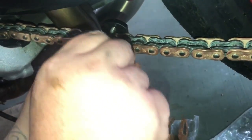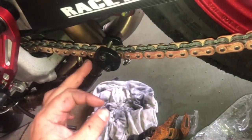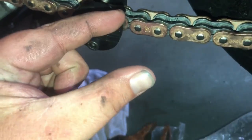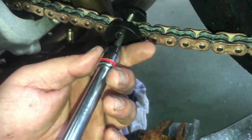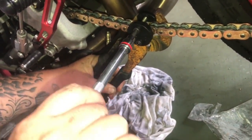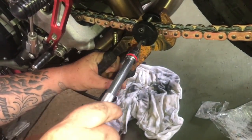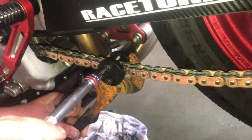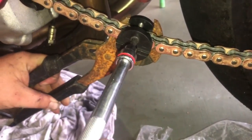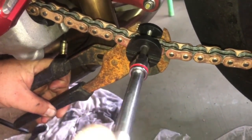All right, and then it calls for, we want 2.7 to 2.9 on these rivet heads. So we wanna spread it out with this flare tool, and then that will be within spec. So we're gonna grab our channel locks to hold it on the back, and we're gonna start A, B. There's no need to rush through this part because if the chain is too tight, it's gonna kink. And then you're gonna have issues with it rotating around the sprockets. So let's go ahead, that's number one done. We'll go ahead and see how we're flared on it.